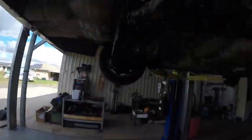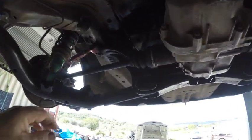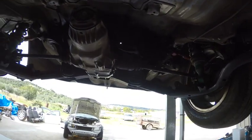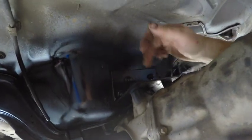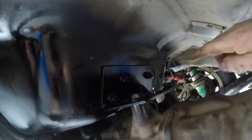Video two for the Civic, week two. We have the diff all mounted and the CV shafts are in. We used two left-hand CRV CV shaft mounts. That's the CRV rear diff. We made the mount — it's pretty normal to what we've made before. It just bolts to the top of the diff; the two bolt holes are already in the casting, and then it bolts through the floor with four bolts.